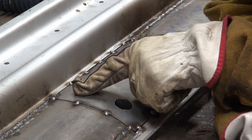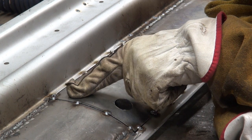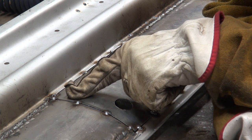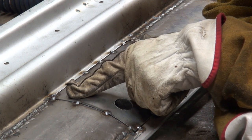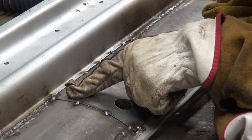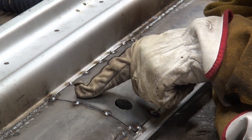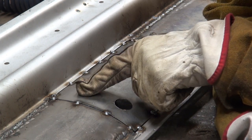At this point I've got my plug weld tool on the backside of this metal. That allows me to fill in this long gap without a great big weld falling through the opposite side. I'm going to turn my 210 amp welder up to setting two out of six, and then start doing one little tack weld at a time, going about an eighth of an inch per weld and cooling in between every single weld.